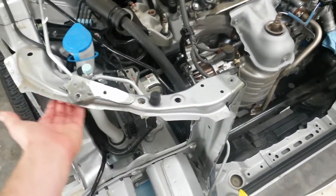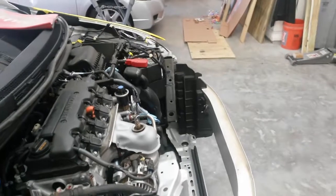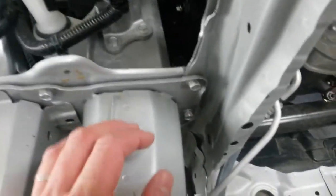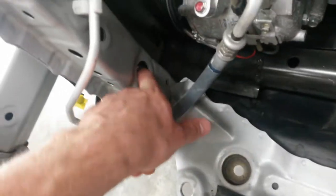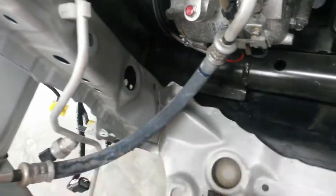I'm going to have to knock this buckle out of it, keep it out, but this has got to come out probably, if you look across, it's at least an inch, maybe more. But this is going to be a better repair than cutting all this out, because it's not torn away anywhere. There's a buckle down there. I don't know if you can see that. Right in there, it's buckled. But I've got an access hole back here conveniently, and I can go in there with a wooden dowel or something and just tap that back out.